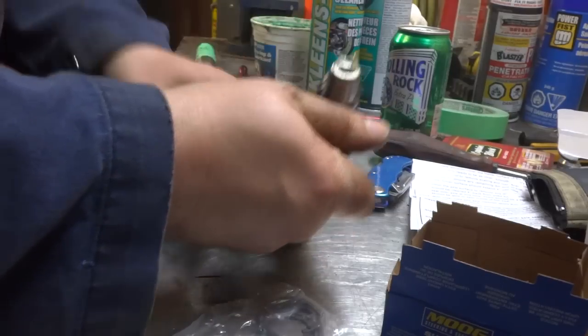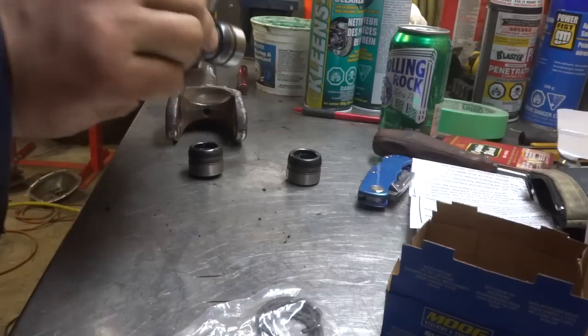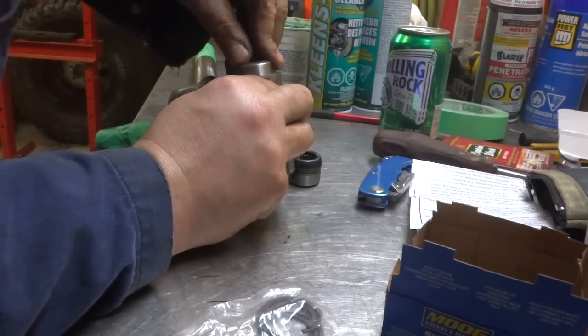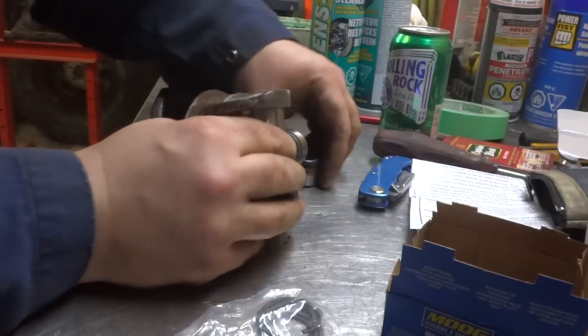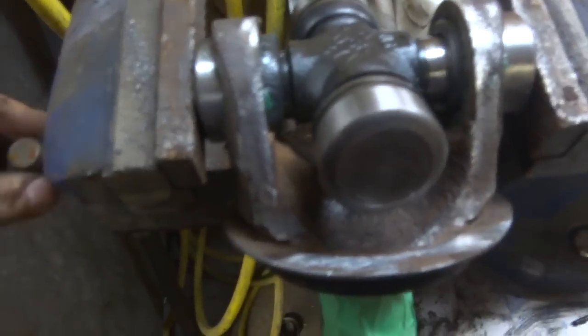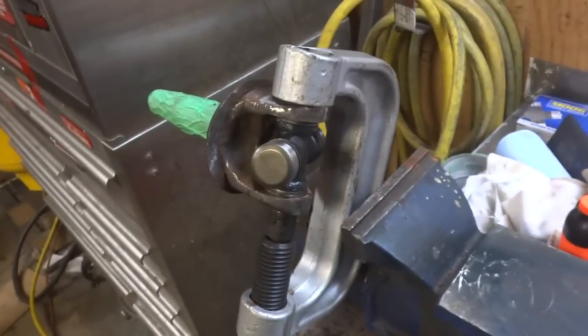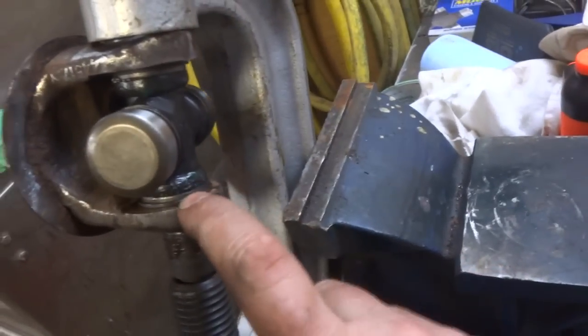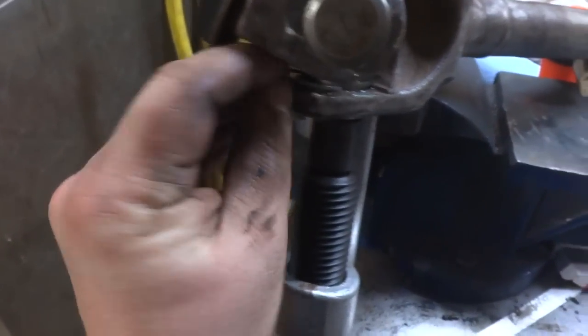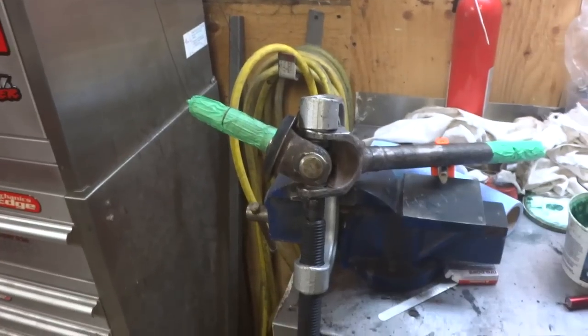Remove the cups, put them through both sides. If you're careful, I just put these in a vise and squish them in. Sometimes it may be necessary to use a ball joint or U-joint press again to push the cup up enough, because one side might not be able to go in — but be careful not to damage it. Once you get the other one, it's the same thing. Take your clip, slide it into place, and then one front drive shaft is done.